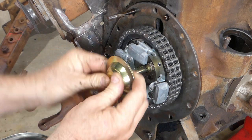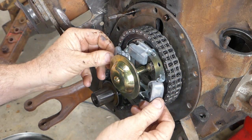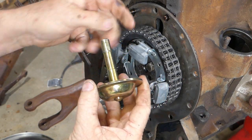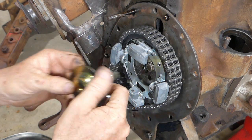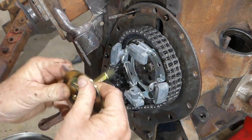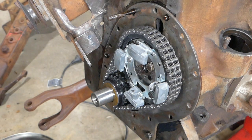That's the little mushroom to the governor, and it's a bit too tight. It just needs to float in and out freely with the weight of these. I think they make the parts and sometimes the CAD plating from suppliers puts them oversize. I'll have to polish this up a bit, then tighten everything up and get it ready to put the front cover on.